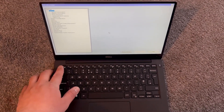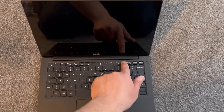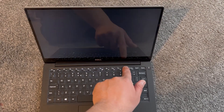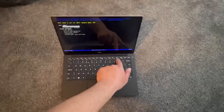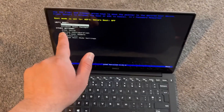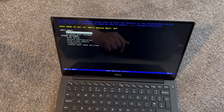I'm going to escape this and show you how to enter boot menu options. Once the laptop restarts, keep tapping the F12 key this time. This is the boot menu options for the Dell XPS 13 9360. Your bootable drive will show up just below the primary drive.